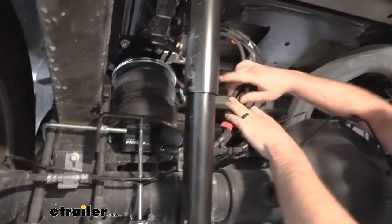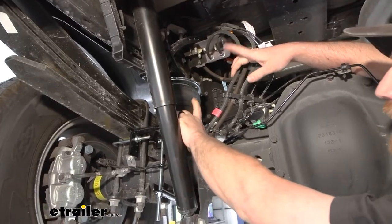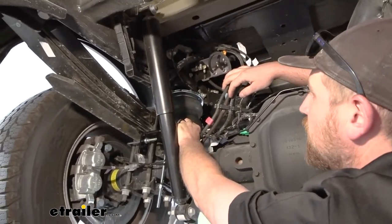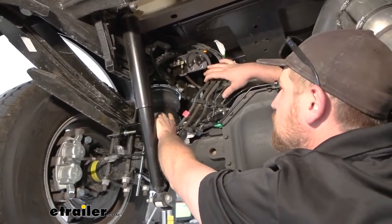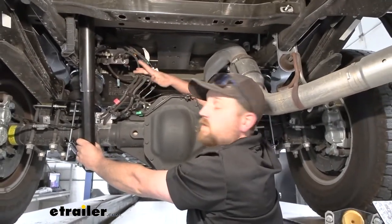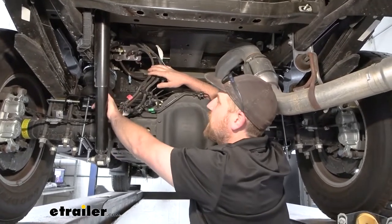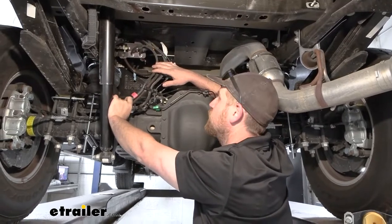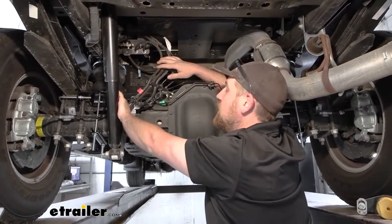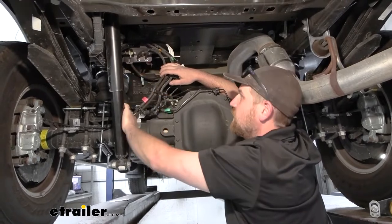One of the cool things about airbags is that they're adjustable. You can run a minimum of five pounds all the way up to a hundred PSI, so you can really fine tune them depending on your load — lighter load, use less; heavier load, use more. You can always use a compressor too. I like the Air Lift easy mount wireless one and have had a lot of good luck with them. Using a compressor also takes care of maintenance, because the bags do require at least five pounds of air in them. If you ignore that, the bag could potentially get damaged and create a hazardous situation. Keep that in mind on fall days where it's warmer out and cooler overnight — pressures drop.